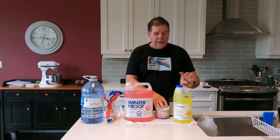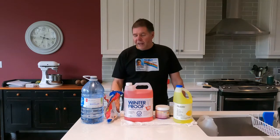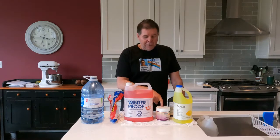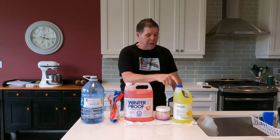Hey YouTube, today I'm going to make tubeless tire sealant the homemade way. For that we need liquid latex — you can find that at a model building shop; in Canada I use Michael's. We also need ammonia, RV antifreeze, water, and cornmeal. The recipe is by parts: one part liquid latex, one part antifreeze, two parts water, and half part ammonia.